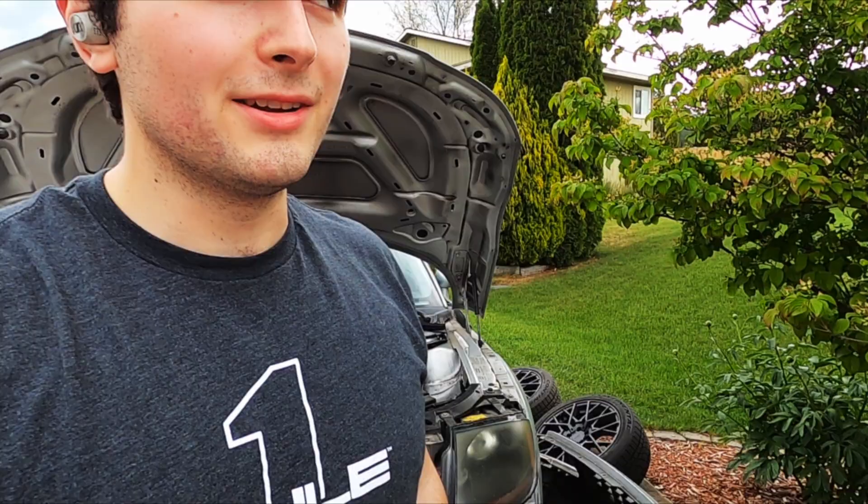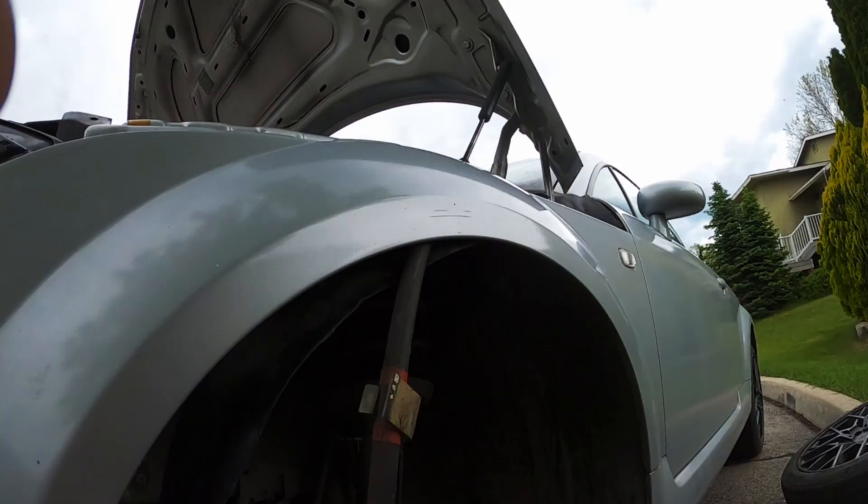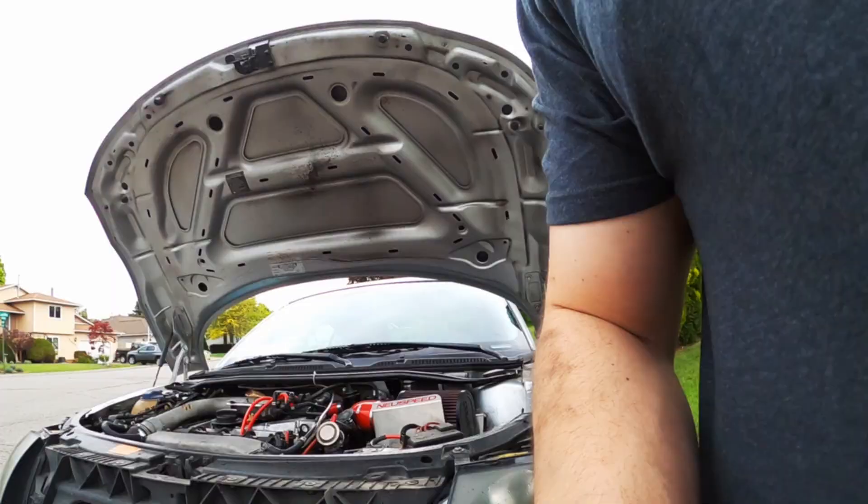My coolant was pretty low, but if yours isn't, you may want to consider draining it before you do this. Since the headlight washer system is being deleted for the intercooler, I put a bolt in the hose and stopped all the leaks. I also cut the hose short enough so that it'll hide perfectly under the fender. You can also get rid of the two air ducts in front of each of the intercoolers. It started to rain a little bit, so now I have to wait for it to clear — but we have to prep the bumper anyway, so now's a good time to do it.